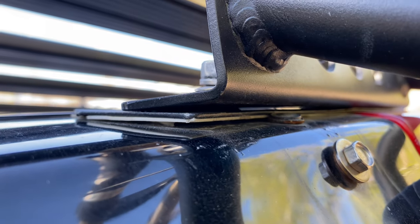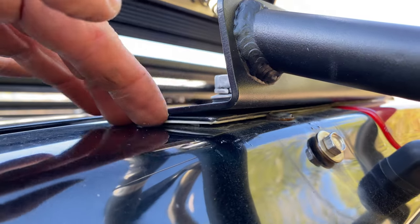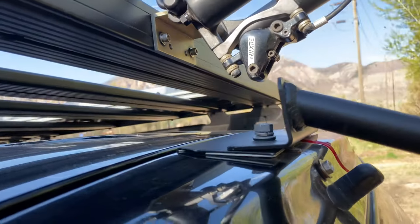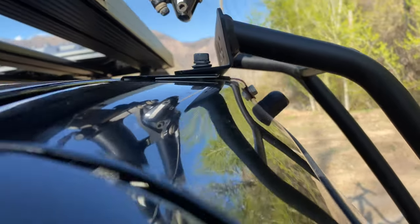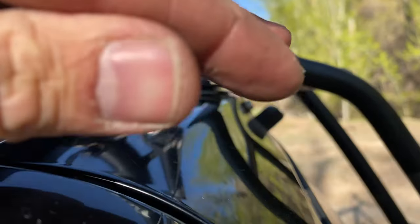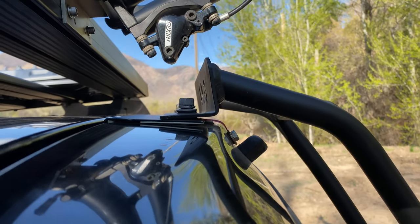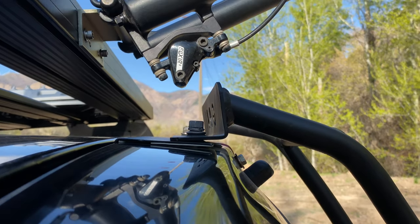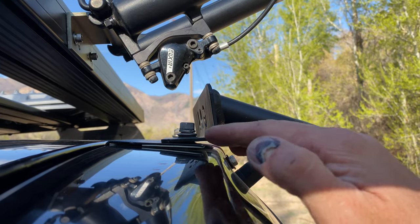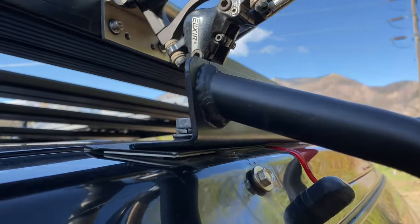And secondly, this side of the base plate, I took to the vise and tweaked it a fair amount, bent it so that it would kind of come down and wrap around a little bit and touch the top of the hatch. Otherwise it was just straight flat and it really wouldn't have touched the sticky mount. It would have been trying to pull itself off the whole time. So those are the only two last little things to mention.